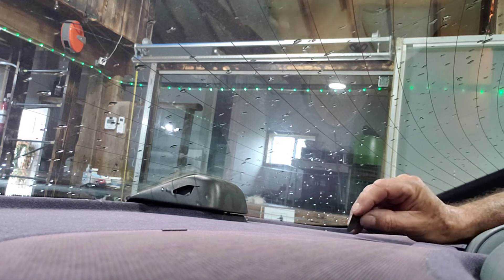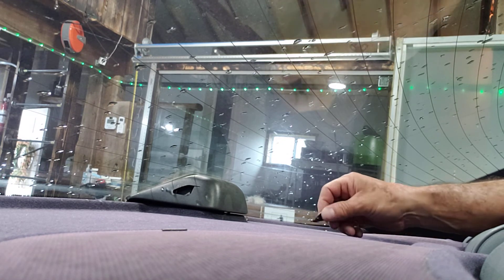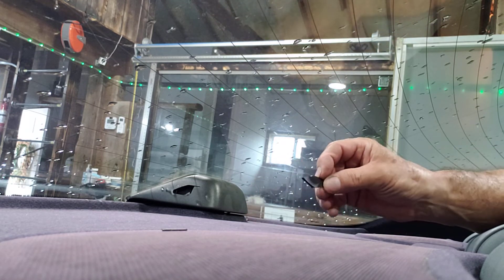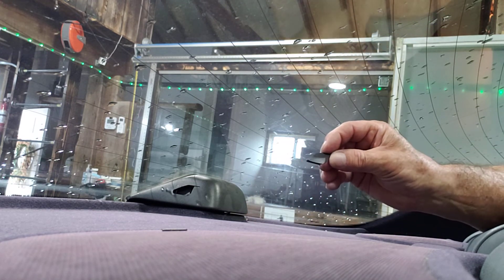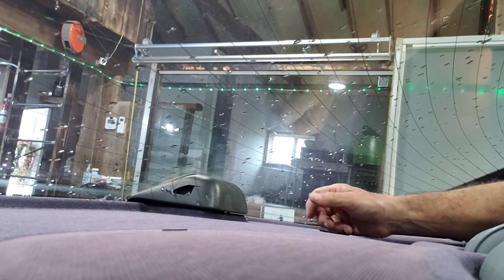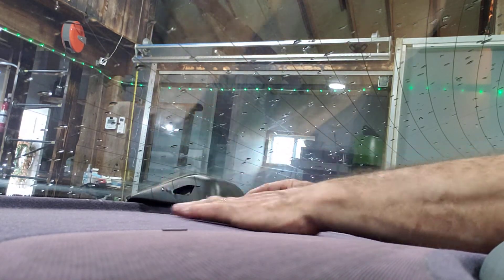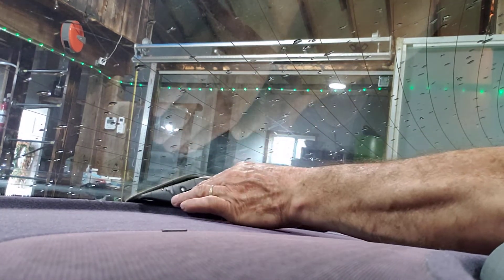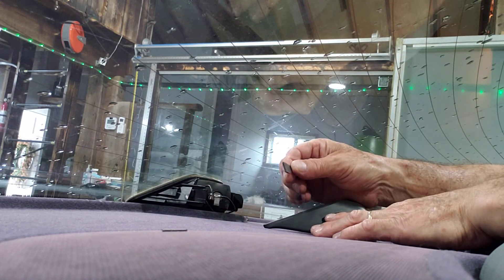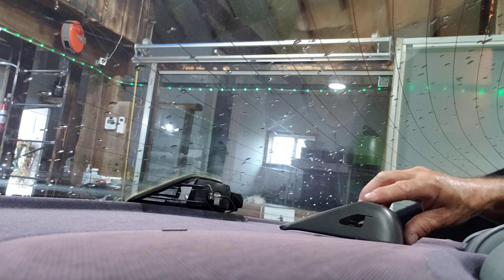It's a very simple thing and there are no screws involved on this third brake light — it's an interesting engineering. If you don't know, it's gonna be a problem. You see this little thing over here? This little thing is already broken — there should be a button on this side, and on both sides there is a button. In order to remove this third brake light you have to remove this cover, push the button in and slide it out. But as you can see, the sun has done its job and this thing is already broken.